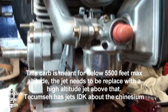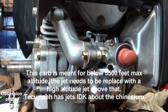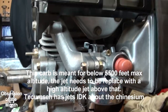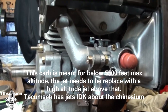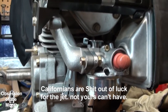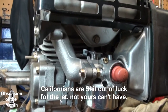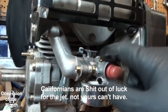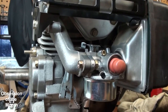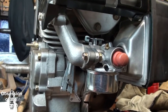There is no high speed throttle adjustment, there's just an idle. And as you saw in the video, basically you want to adjust it so that when you come off of full throttle, the engine doesn't quit. So you want to compromise. I think the idle on this is supposed to be around 1750, but with the fixed idle jets in this thing, or the fixed jets, it's kind of difficult to get this thing to behave properly. So basically, bump your idle up until it doesn't quit when you take it off of full throttle.